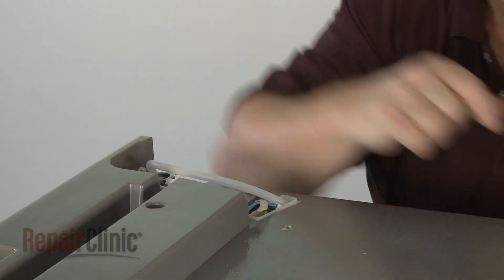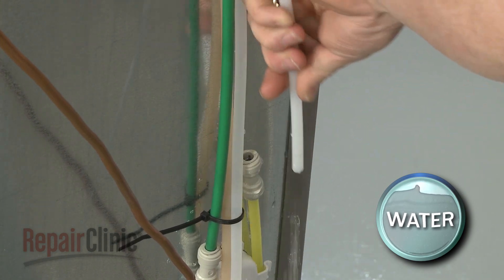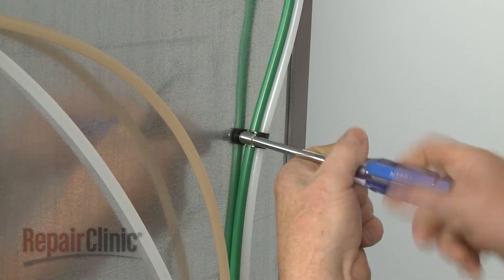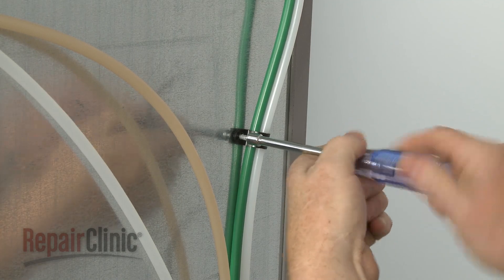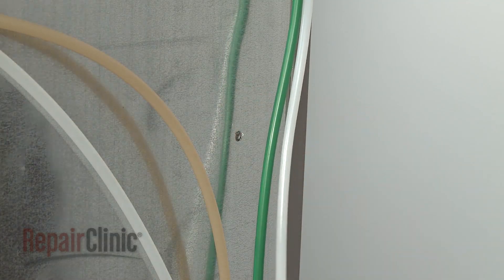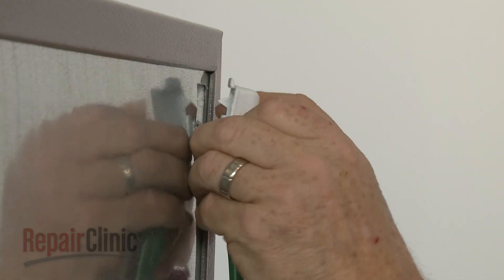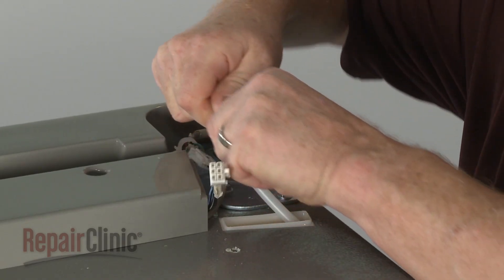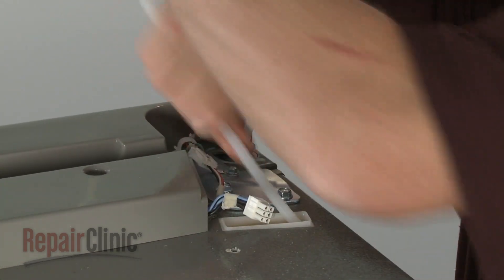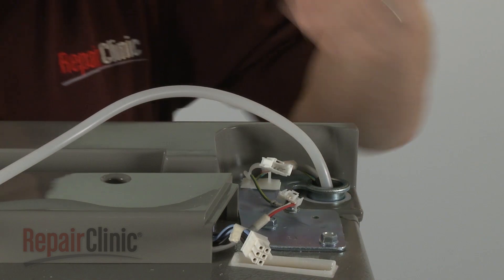To fully remove the left side door, use a small wrench to depress the locking ring to release the white water dispenser tube from the coupler. Unthread the screw to release the tube retainer. Slide off the retainer. Detach the tube cover as well. Pull the water supply tube out of the channel.